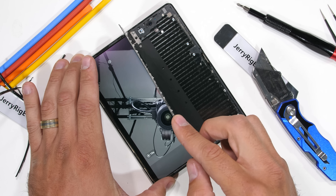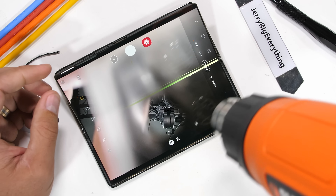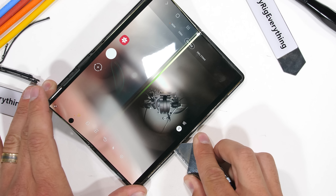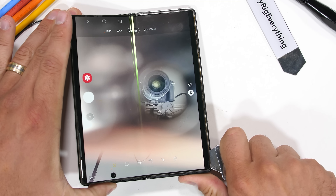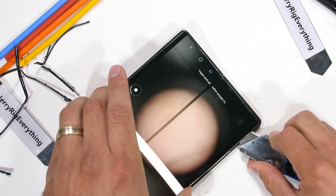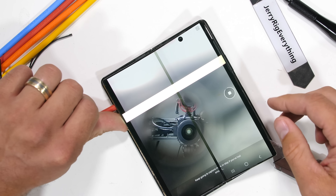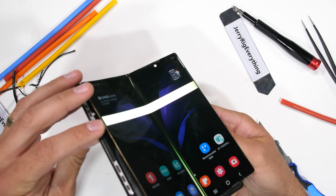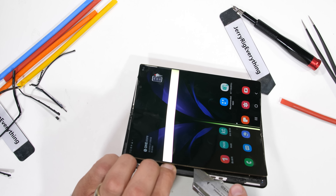You can see the front-facing camera peeking up through the display as it gets lifted up and down — kind of fun, thumbs up for that. I'll warm up the other half of the display and then use my same razor blade trick underneath the metal plate to pry it off in working condition. It's a flexible folding display, so we should be able to bend it up as long as we don't touch the edge too much. Since we removed that edge protection, we touched the edge — the whole line of pixels is now toast because I squeezed the edge of the screen. With a few more carefully placed slices, we are able to remove the rest of the adhesive holding the screen to the body, and all we're left with is the ribbon cable that connects the display to the internal motherboard.